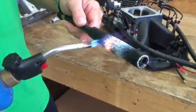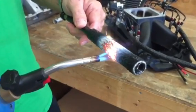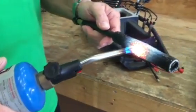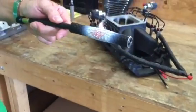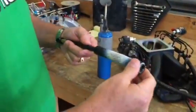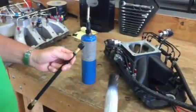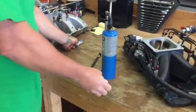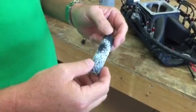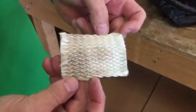But it really doesn't do anything — it's pretty tough stuff, something we've done a little bit of testing with and are really happy with. Not many car fires last very long, but once you get through a nitrous line you can really have trouble. If you look through it, it's kept the nitrous line and it's not even hot to the touch. This other piece we lit up pretty hard — had it glowing to where you could almost see the weave through it — and I've actually cut it and you can barely see any of the heat that transferred through.